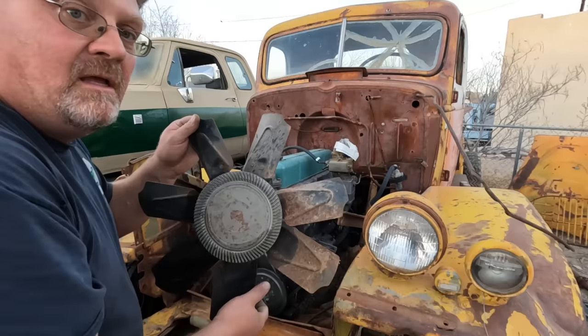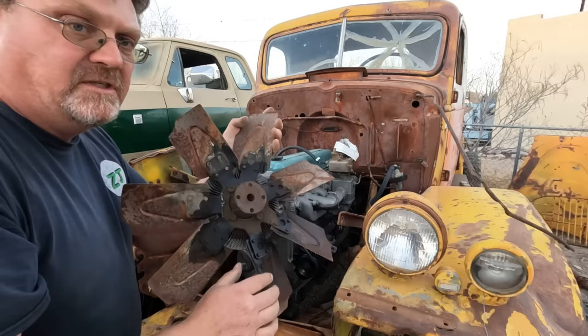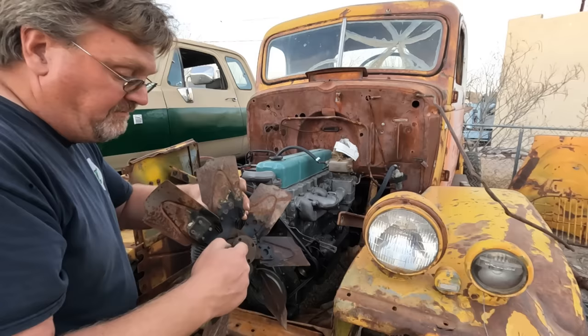Now here's a thermostatic fan. Same standard modern mounting, 5/8 pilot, and the holes drilled, I think they're a little over 2 inches across. And that looks about right for spacing, but I'd have to bore the pilot out. And I'd have to re-drill these holes. There's no real good way to hold this in a machine to drill them.